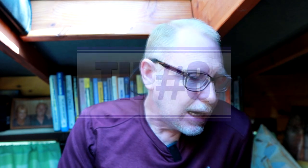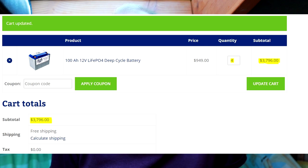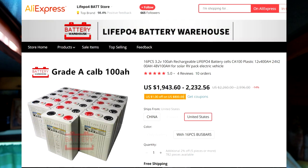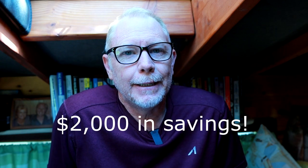Let's talk about brand-name solar gear, because almost everybody converting a cargo trailer has to do solar in some capacity. I'm doing a big array with 1,000 watts of panels and 400 amp-hours of lithium-ion batteries. Battleborn is like the biggest name in the industry — really nice batteries made in the USA with a fantastic warranty — but they're $1,000 per battery. I did my research on AliExpress and found Chinese batteries at half the cost. I do have to add a battery management system, which adds a couple hundred bucks, but my Battleborn cost would have been about $4,000 for 400 amp-hours, while my DIY lithium-ion cell array is $2,000. So if you're willing to learn and do the research, especially in solar, you can save a lot of money.